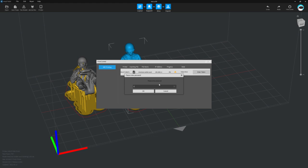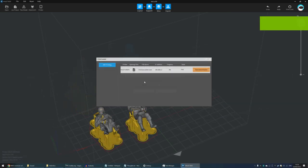I didn't set a password and couldn't find an option to set one in the printer. I searched online and couldn't find any help there either. In the end I had to contact Technical Support who, to be fair, answered me quite quickly within a couple of hours. It turns out you have to set the password under the camera monitoring section of the 3D printer settings — that's the password you enter into the slicer software and then it works. It's a bit unintuitive, but it works in the end. For some reason it doesn't work with a blank password, which is what it comes with out of the box.